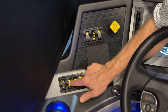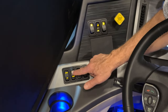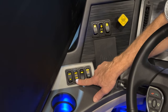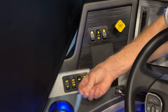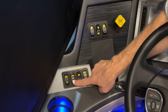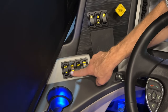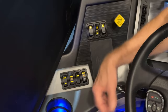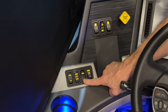The house battery boost switch lets you use one battery bank to help the other. If batteries are low on the house or chassis side, toggle up or down to connect them. Hold down for 60 seconds to engage the charge bridge solenoid — both banks connect and you'll be able to start the coach. If both banks are too low, you'll need to charge them externally.